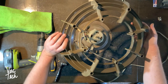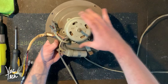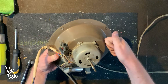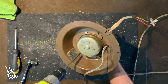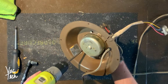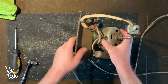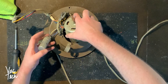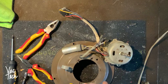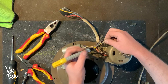Now another part I can just wash. I've got this thing apart in layers. The last thing I'm going to do is remove the motor, which is sandwiched in here. It's still plastic but this motor feels pretty heavy, and that might be an oil port right there. It's held in with six screws - three on the bottom and three on the top. I've got different types of screws so I'm going to label them along the way. Here's the motor with a couple cord grommets I've got to work through to get the wiring out. I'm going to mark what wires go where before I separate them.